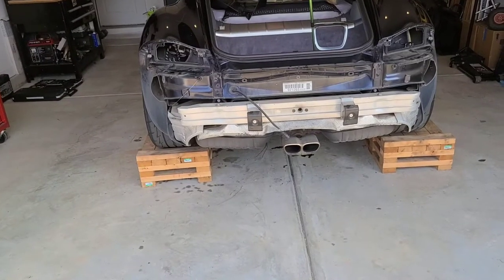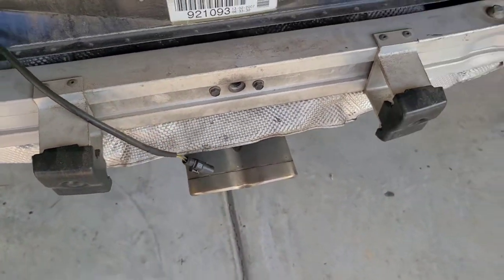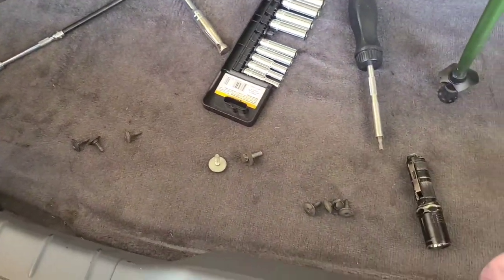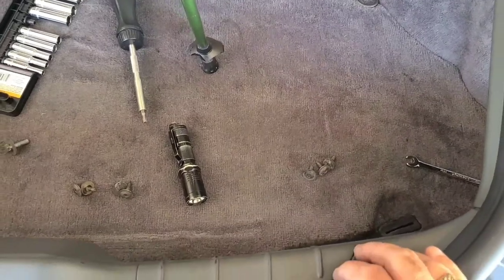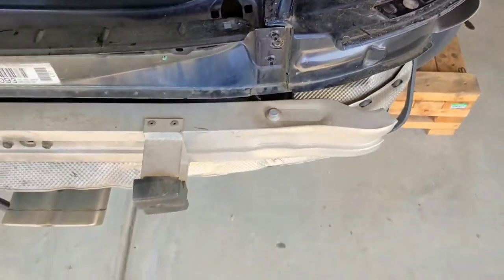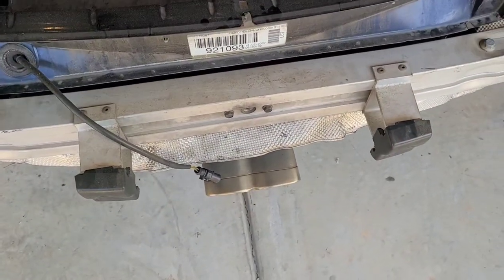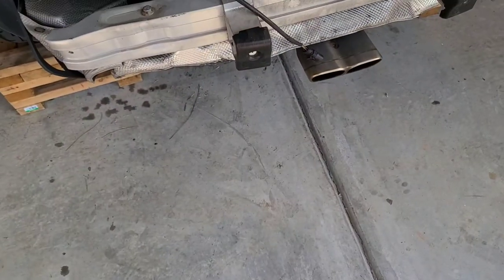The rear bumper is now removed. Here's the connection for the rear impact sensors, and here's the hardware: three from the driver's side, two bolts from that bracket where I'd already removed the third and never reinstalled it, four from the very bottom - two for each side - and three T25s for the light area. In the US they require these rear impact guards. If you put a euro bumper on it, all you've got to do is drill out these rivets - two on the top and two on the bottom for each side.